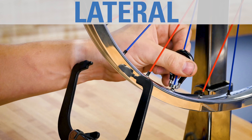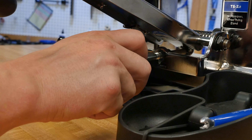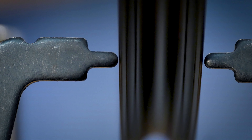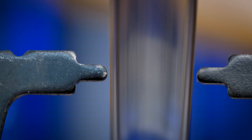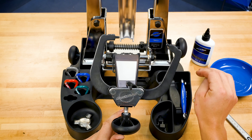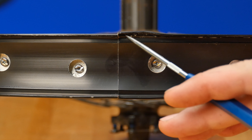Lateral truing is the side-to-side correction of wobbles or lateral deviations as the wheel spins. When truing wheels, generally begin by first correcting the lateral or side-to-side aspect. If we watch here at the truing stand indicator, we can see this slight side-to-side motion — this wheel has adequate lateral truing. But this rim has quite a bit of lateral error, and with a lot of lateral error the tire can even rub against the frame. Adjusting the tension of specific spokes can move sections of the rim to help correct lateral errors. However, there are limits to what changes in spoke tension can accomplish. If the rim metal has been bent in a crash or by impact, it may not be possible to get it adequately straight.